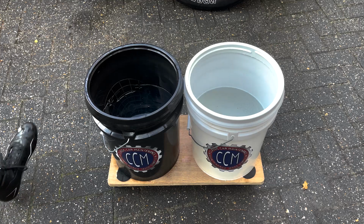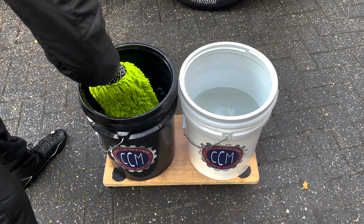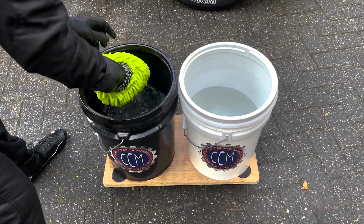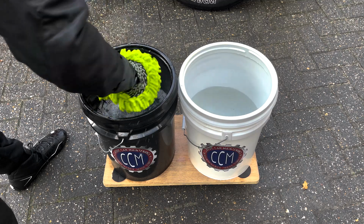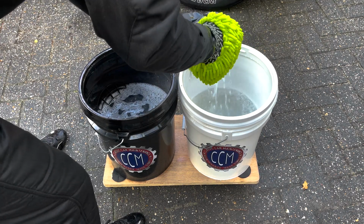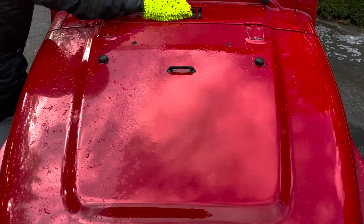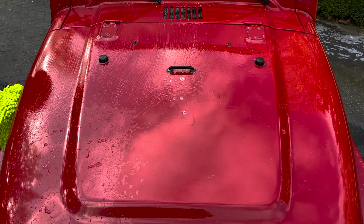What's so great about a washboard bucket insert is that you can dislodge all the embedded contaminants from your wash mitt's chenille material. All the dirty, gritty bits will sink to the bottom of your rinsing bucket where they are trapped beneath the grit guard. They are safely contained out of reach of your wash mitt where they can't cause scratches or marring. The two-bucket method with grit guards and a washboard keeps your soapy water clean much longer too, allowing for a much more efficient washing process.